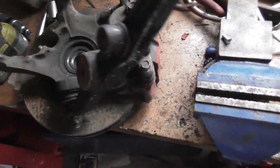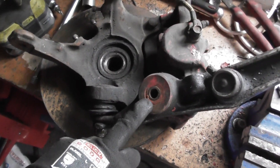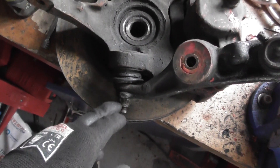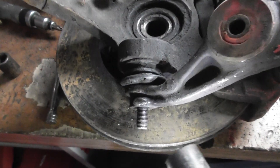First I'm going to try and strip the whole thing down and replace whatever I need to replace. So first of all, this is the front control arm, and what I'm going to do is just undo this bolt here. You can see someone's had a go and tried to round it a little bit, and we'll see how I fare with a 19. I'll use the impact gun to crack it off. Success — that's pretty good.